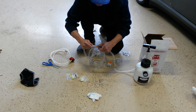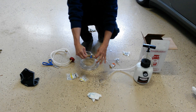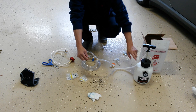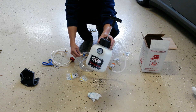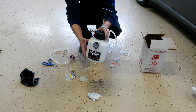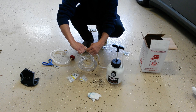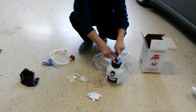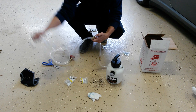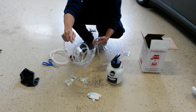We make the final connection here and properly clamp both sides. Depending on the pressure, it will typically pump up to about 15 to 20 psi or so. You fill up your Motive bleeder bottle with the type of fluid you want — whether differential fluid or transmission fluid. Close the valve to the closed position, pump up to 15-20 psi, then put the end of the hose into the fill hole and open up your valve.